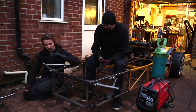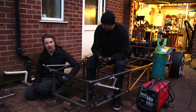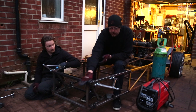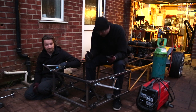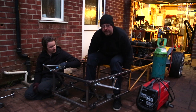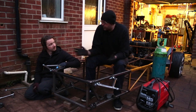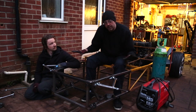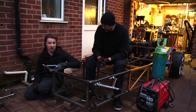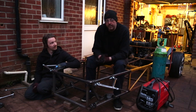It's been a pretty good day today. We've adjusted our suspension bracket so we can now get all of our range of motion on the upper arms with no interference. We've got our steering rack mounts fully welded in, finished off the tops so they're all sealed and we're not going to get a load of water in them. We've taken out our firewall panels which were a little bit rubbish but we need them out to fix a few things, and we've finished off our lower joints as well. All we need to do is put the rest of our suspension back together, and then maybe next time we'll actually get some springs in and this will be done. We're actually getting pretty close to done with the front end of the chassis now, so before too long we'll be looking at getting all the steering wheel in and actually starting to make it work as a car — which is going to be kind of terrifying.